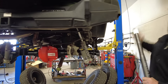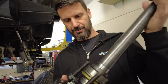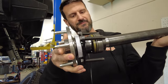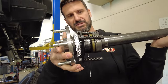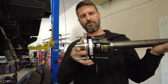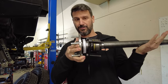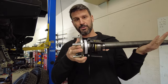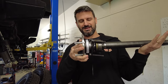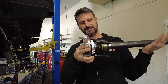Here is a rear axle shaft from this setup — look at the size of that. There's a lot of radius coming off of that axle shaft and transitioning into the axle flange itself. That much material on the bone is going to keep that flange from bending, unlike it would on a stock 30 or even 32-spline Rubicon variant. That radius on the stock axle shaft is a lot smaller, and that's where you bend those axle shafts most of the time.